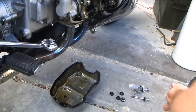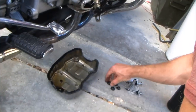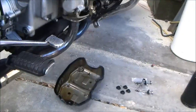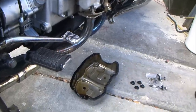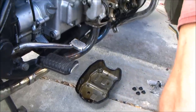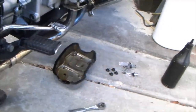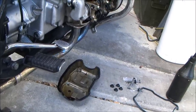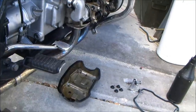You got your new ones sitting there? Yeah, the new ones are right here. Use the new washers — make sure that you set your old washers off separate, because sometimes those washers will bow in too. It wouldn't seem like the rubber would be enough to make them do it, but sometimes they do. Usually that's on one of the single-cam bikes with a one-piece valve cover with just the two bolts on top — those little twins. These things get messed up.